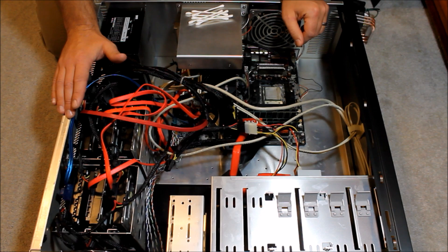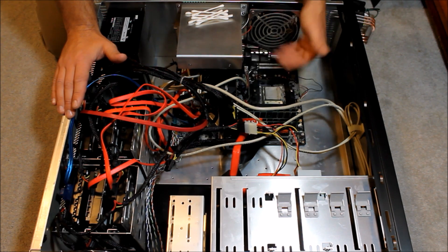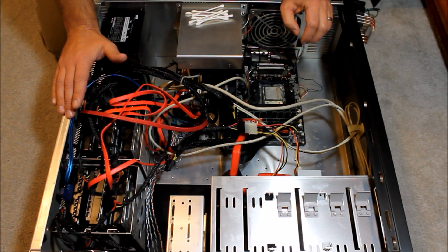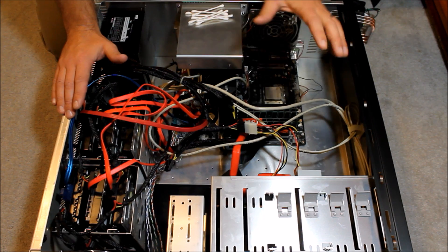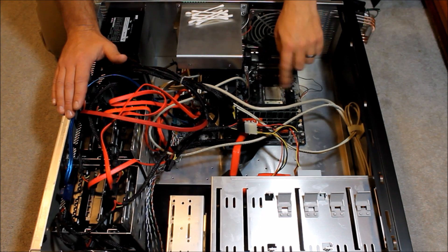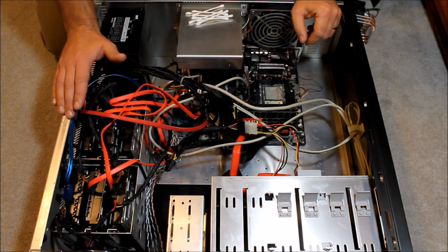You might get very slow performance. That can happen when your CPU fan gets very dusty and it's not getting the heat away. When the processor runs hot, your computer runs slow basically. So the cooler you can keep it, the better off you are. In my case, this computer is pretty old and I got that message saying it was not functioning. I opened the cover up and it's just not spinning at all. I could spin it with my finger and it would go a couple times and stop. So I knew it was time to replace it.